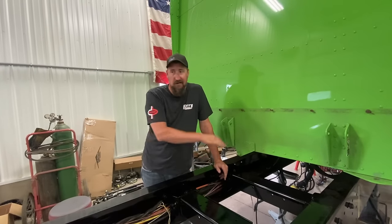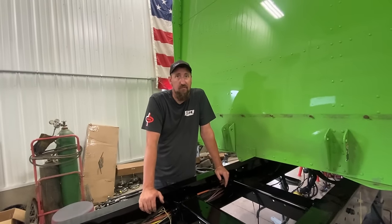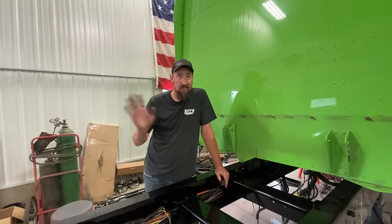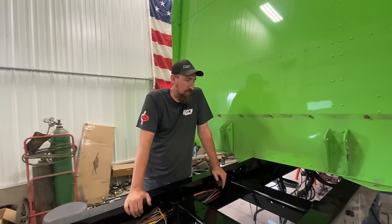So we took every drive shaft out of it. Everyone got balanced. Everyone got reworked. New U-joints, and new slip joints if they were sloppy. I mean, they all seemed good, but I told them whatever it needs, it gets. Well, you might as well. It's there. That's kind of the way we do things. So yeah, we got to go get them.